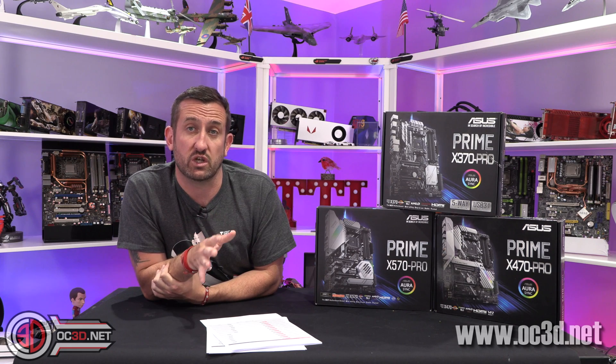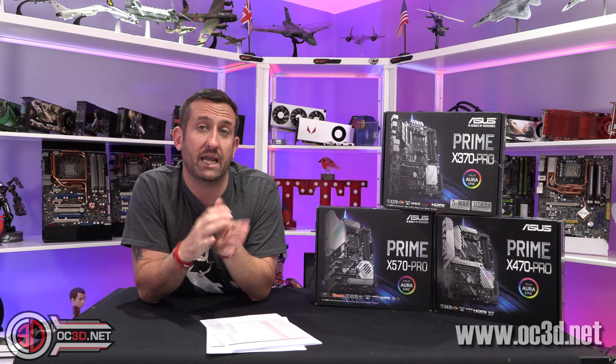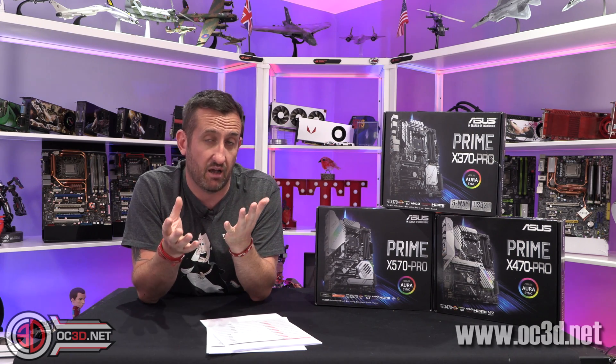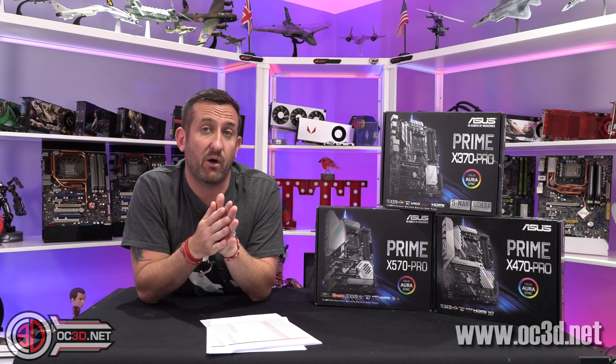Before I close — if you've got the kit already, before you buy your new CPU, make sure you update the BIOS. If you update the BIOS, then when you drop the new CPU in it will run straight away. And that's the only thing you need to think about. Also, if you're going to buy an X370 board as a cheap way to get in on the Ryzen 3000 setup, and you're going to buy a second-hand board and then buy a processor like the 3600X, then cool — but you are going to need to make sure it's running the most recent BIOS.